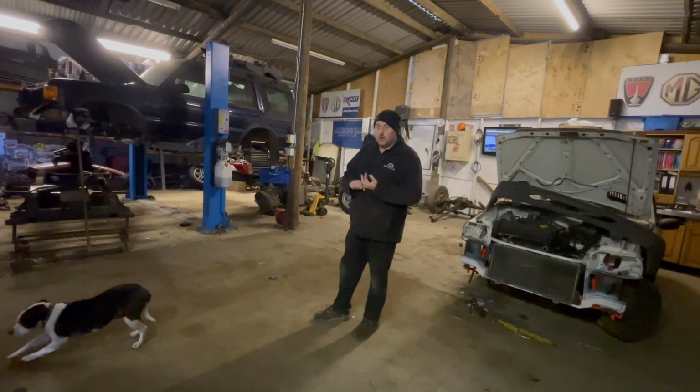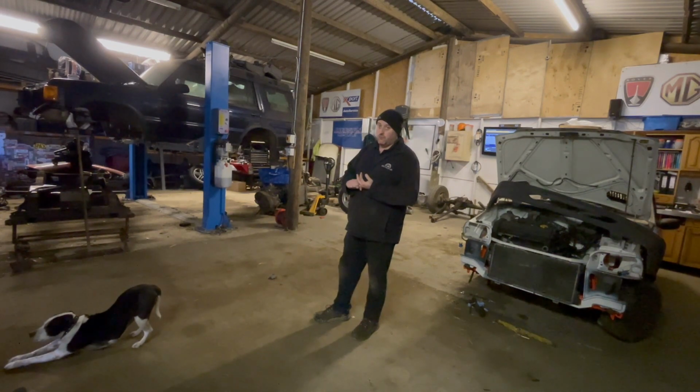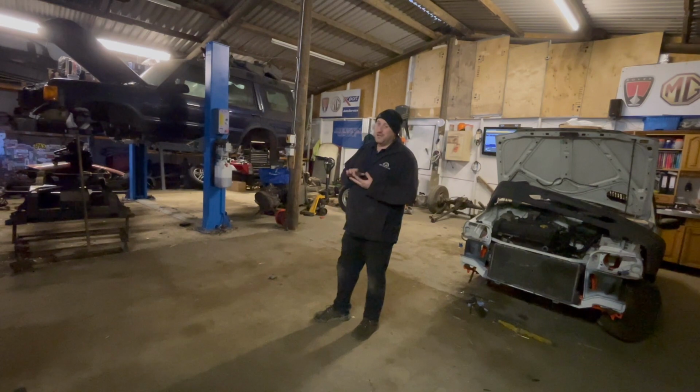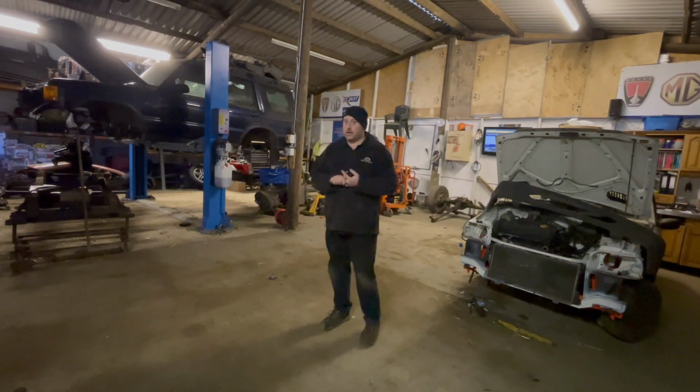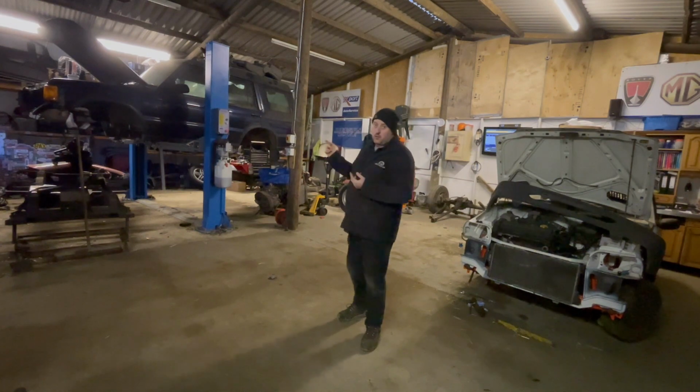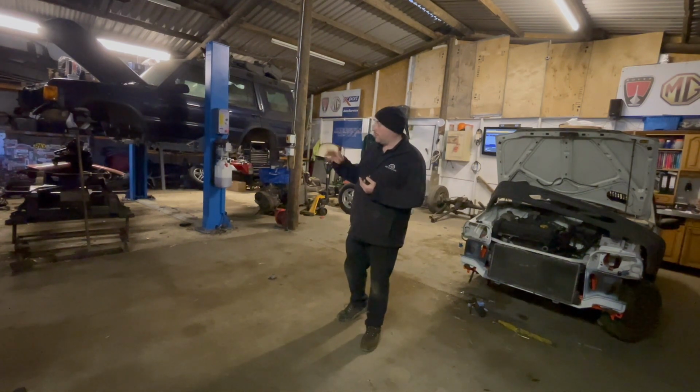The Mini 7, we've got to check over what the rotating noise is. It's either going to be wheel bearing, drive shaft carrier, gearbox, clutch. I'm going towards the gearbox route because it's kind of a diff whiny noise. When you dip the clutch, it changes slightly. So I can't see it being a wheel bearing or the shaft carrier because that wouldn't change when you dip the clutch. So I think that's all what come out. You saw I stripped the other one the other day anyway as a donor, so we've got bits there.